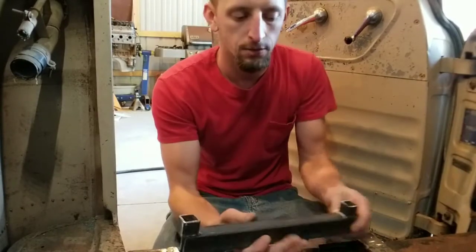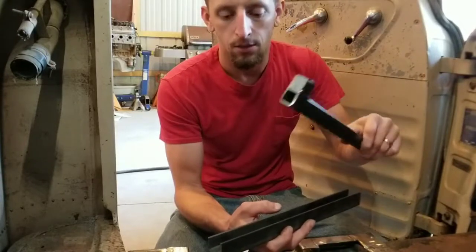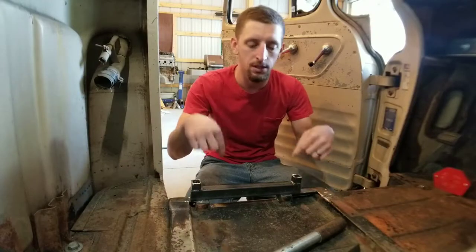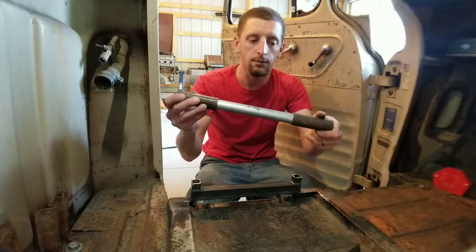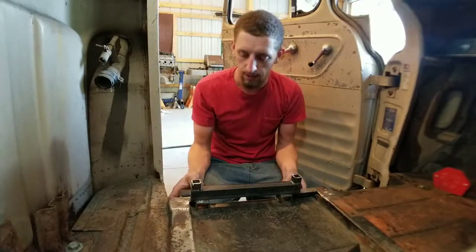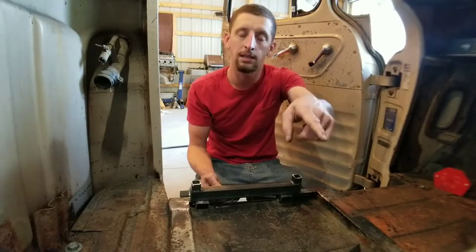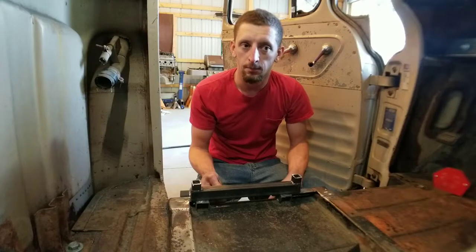I'm going to make a channel for the seat frame — this was seat frame attempt number one, so it's just a cutoff. The idea is to make a channel like this, drop in the seat frame, and mount the seat frame here. This side is going to be the pivot point due to the battery installed under the passenger seat. So I made a barrel bolt out of one inch gas pipe and one inch galvanized tubing. I'm going to mount the hinge on this seat track so the seat can rotate up just enough to get the battery in and out. I want to put some action to it, see if it actually works, and then move on to the next part of the build.